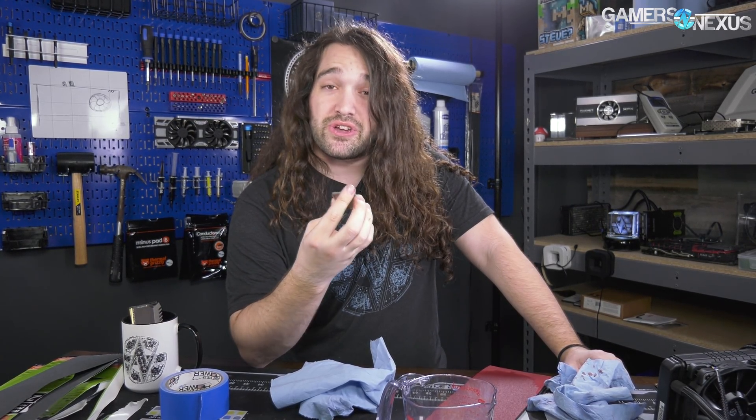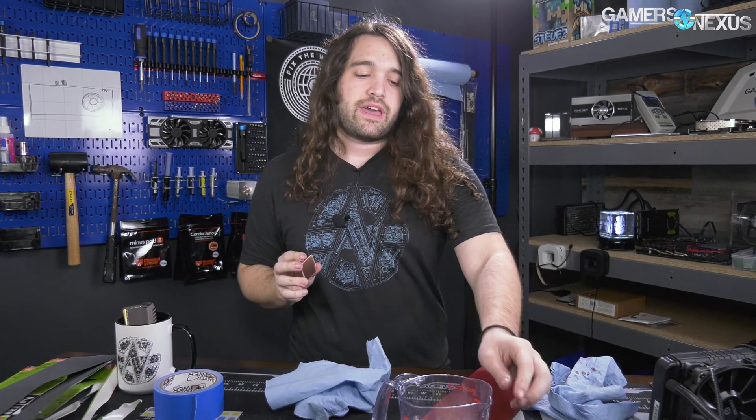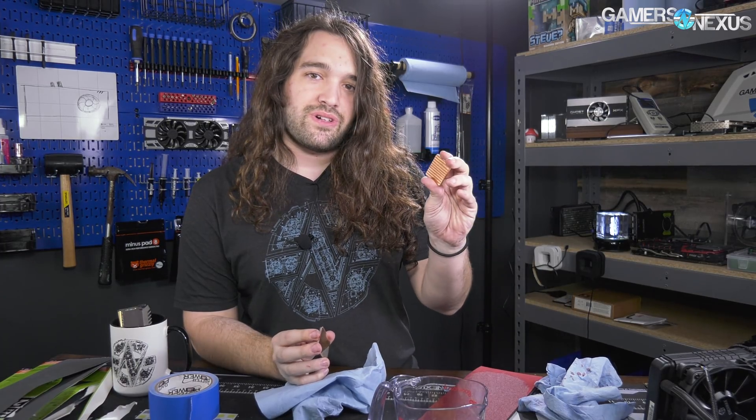So there's a polished IHS for now. I could probably do a bit more with proper polishing tools or something, but it's functionally a mirror right now. So I want to go ahead and test this — it looks pretty damn good. We're going to test this and then come back in the same video and show you the results. We'll see if it makes up the two degree difference, which was pretty close to margin of error anyway, although just outside of it. So we'll see if it makes it up and competes directly with the Rocket Cool IHS.